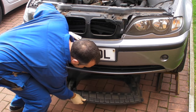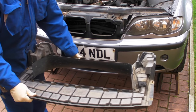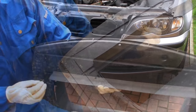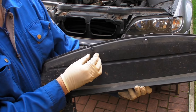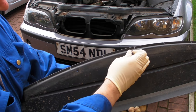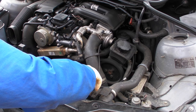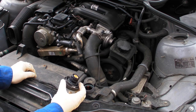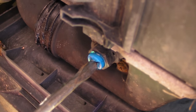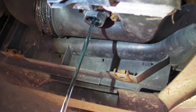The next thing you do is go underneath the car and disconnect all the fittings. There are three plastic ones along the front, and also some down the side — they're just screw fittings but they're a bit corroded. There are about three along the front. Then remove the radiator cap so you can drain down the system, and at the bottom of the radiator unscrew that blue plug and let the system drain down.